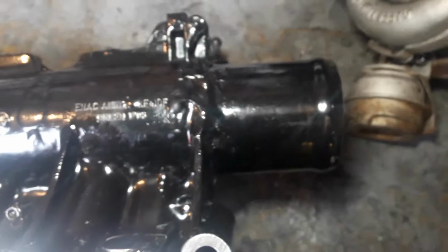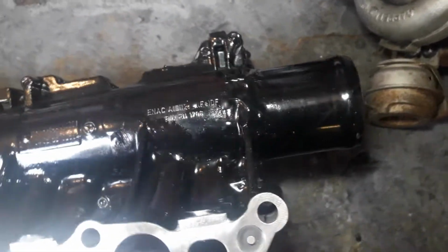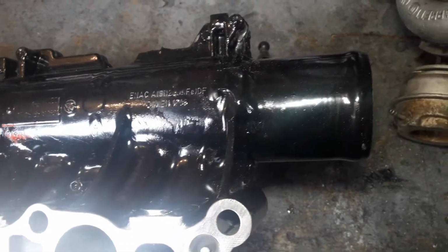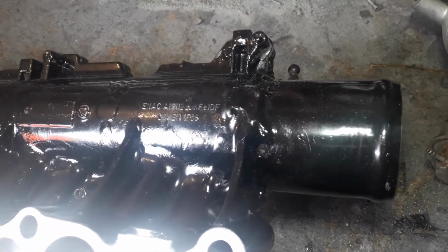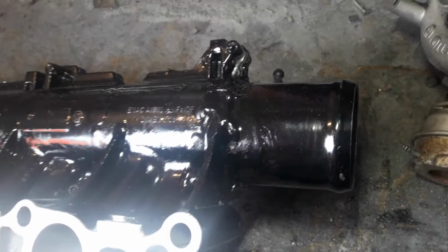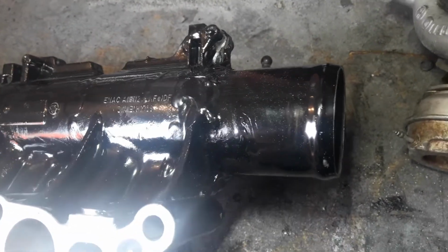And obviously the main part of this is that I've actually removed the Anti Shudder valve. The Anti Shudder valve is often called a throttle body. It isn't a throttle body. Basically, its only purpose is to help mix the EGR part and to shut the engine down smoothly to prevent a nasty little rattle when the engine shuts down, which helps to protect the dual mass flywheel.